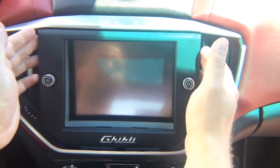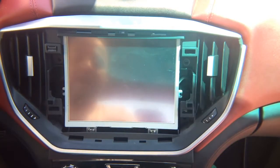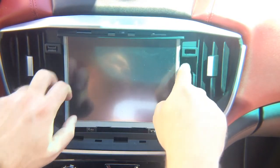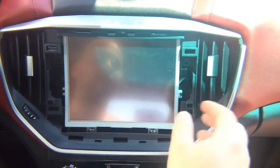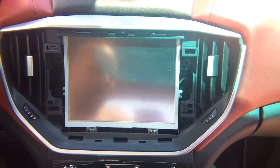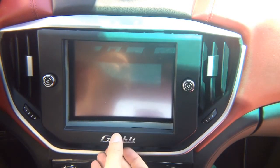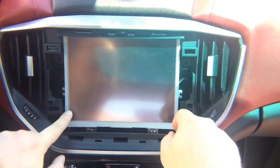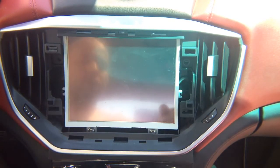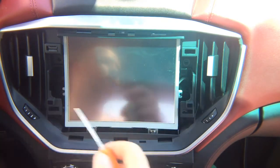Pry the clips, take it out, and disconnect the connectors. Then you've got screws — two screws here and two screws here — and this panel just comes out, but it also has clips all around. The fascia clips are super tight, very hard to come out. Then you've got four screws here; the screw locations are one, two, three, four.